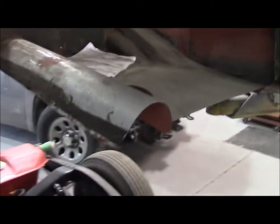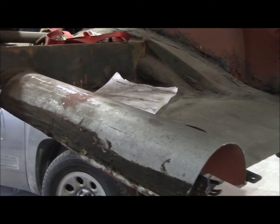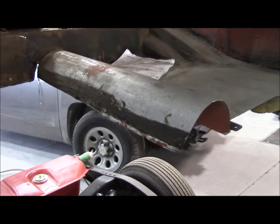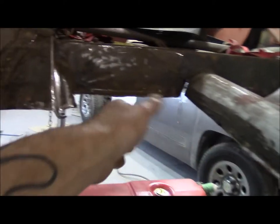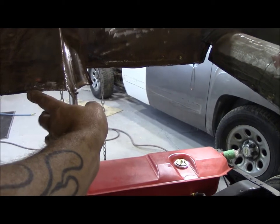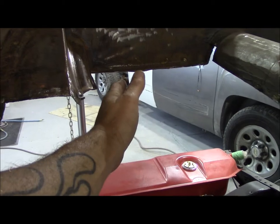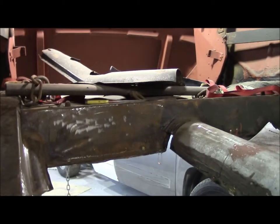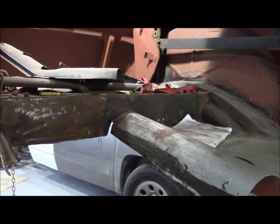You can see them cutting out the back, and look at that — that's all galvanized metal in there. Now these floor pans, they do not make floor pans for a convertible. So these floor pans are only going to come back to here, and that's normally where the floor would stop on a two-door or four-door coupe. But the convertible floor is a little longer because your rumble seat sits up on top there, and beyond this is where your feet would rest. So I'm going to make that panel with some nice beading to match.